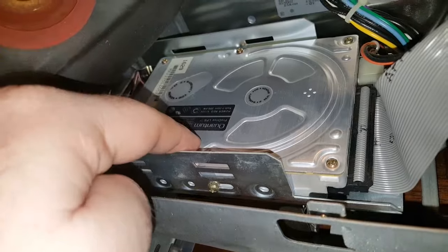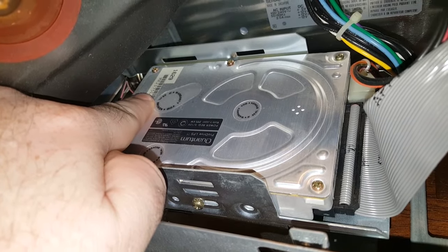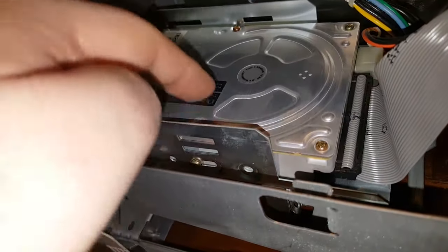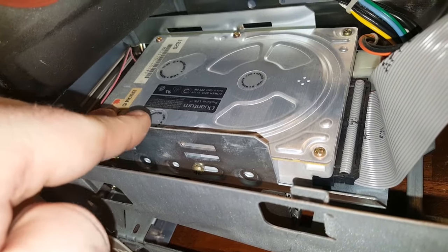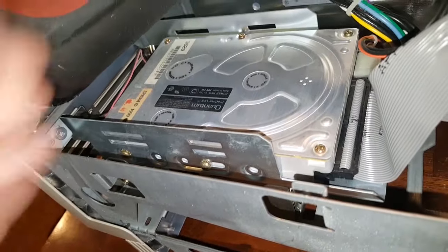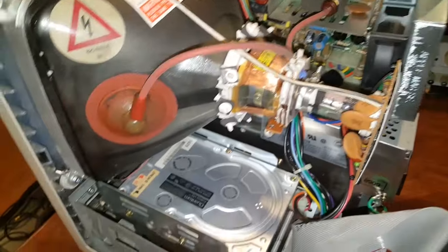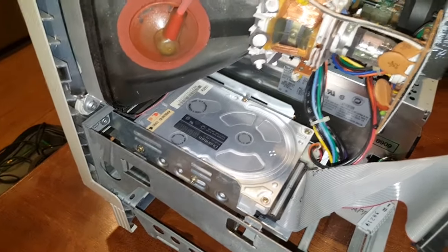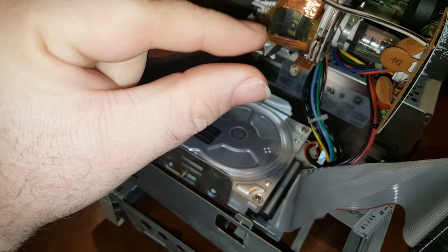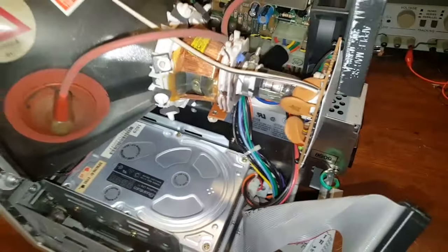There's a rubber home-position stopper in these drives that gets stuck. I've seen two versions: on the 40MB drive the rubber bumper is up by the actuator magnets, which is easy to get to. On the 80MB drives it's under the platter — you have to remove the platter, protect the heads so they don't smack together (which causes cylinder misalignment), replace the rubber bumper, and put it all back. I ruined one set of heads by not being careful enough — you cannot let the heads smack together or you'll bend the spring and the drive won't work again.